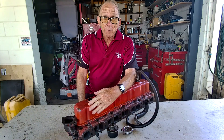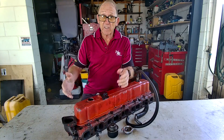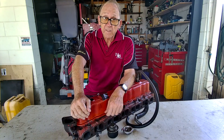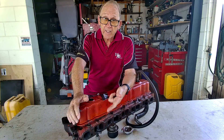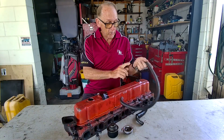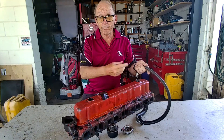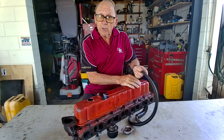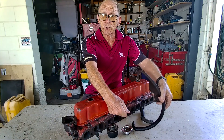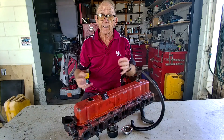Okay folks, MBS here. I'm going to be talking about the PCV valve system in a Holden 6, or virtually any engine. From around the 1970s onwards, every vehicle has been fitted with a PCV valve of some sort. PCV stands for Positive Crankcase Ventilation. It's a little contraption in your tappet cover — that's called the PCV valve — and it rattles when you shake it, which tells you the parts inside are moving. It goes into your tappet cover and then connects to the intake manifold, into the center distribution port.